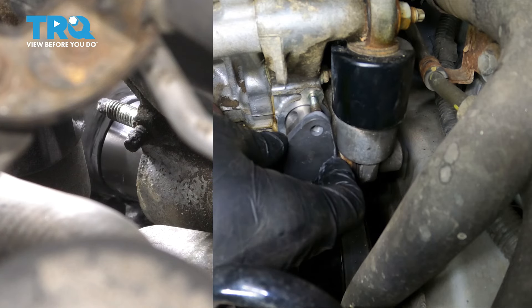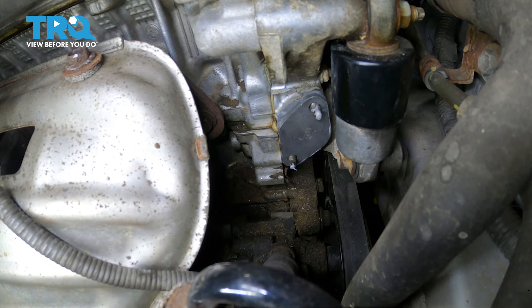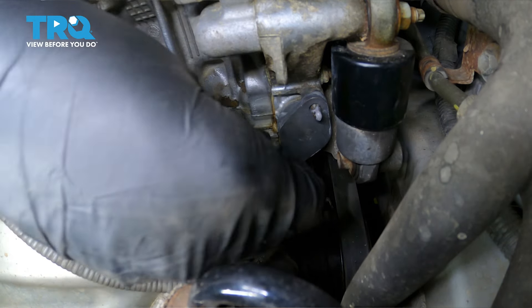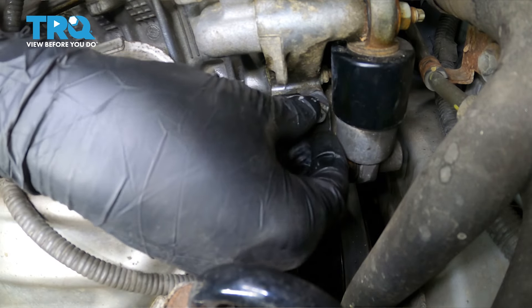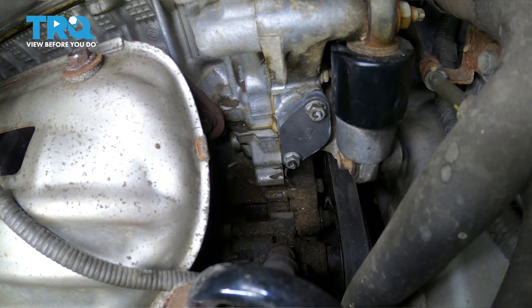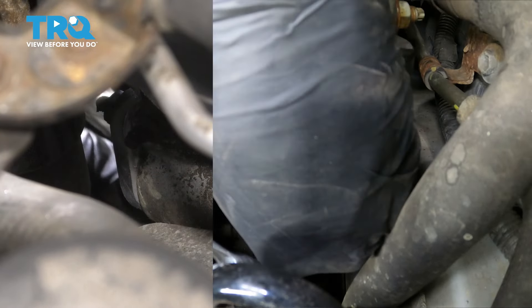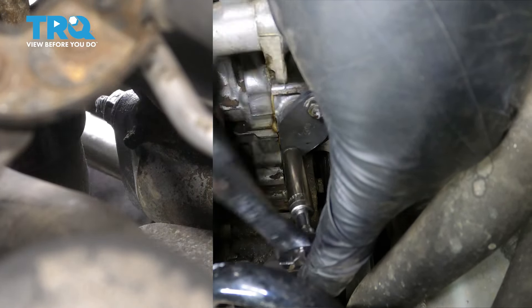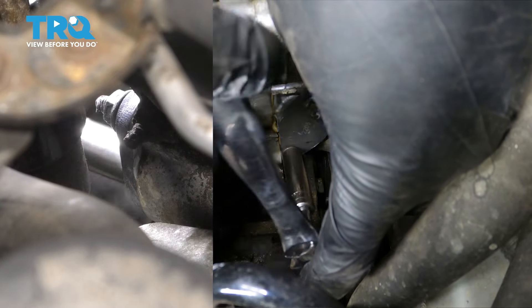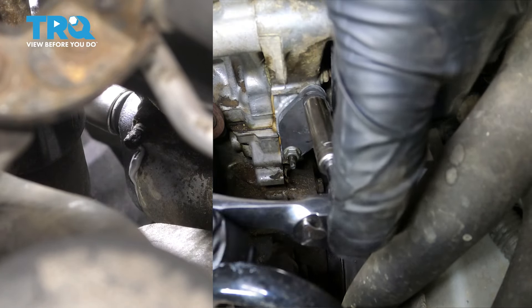We are ready to reinstall. I actually put a very thin layer of RTV on this mounting surface. It doesn't look pretty, but I tried to get the thinnest possible layer. This will help this tensioner seal up for longer. Remember, this little hook goes up at the top. If you can't remember, don't worry — it can only bolt on in one direction. Line it up with the mounting hole, slide it in, push it in all the way. It goes in further than the original because it's compressed and hasn't expanded yet, so you can easily reattach the two mounting nuts.